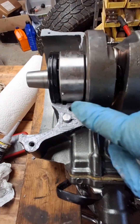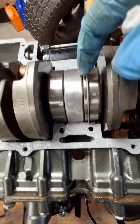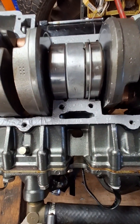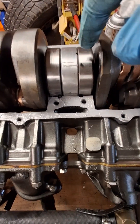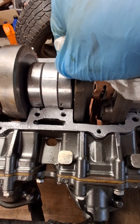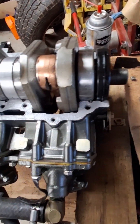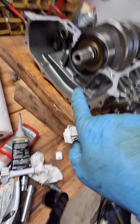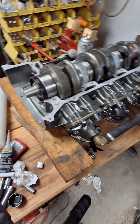You've got this pin here that goes down in that slot. Same with this one — there's a groove right here that has to be straight up and down so that when it goes into the case, there's a pin. This one's got a slot, this one's got a pin, and this one's got a groove that should go down right there. Same with this one. And then this seal's got to fit in that groove. Once it's all lined up and fits snug, I'll have to adjust that.